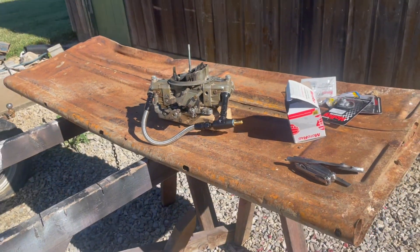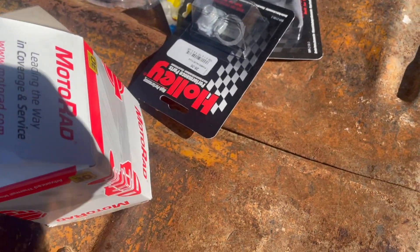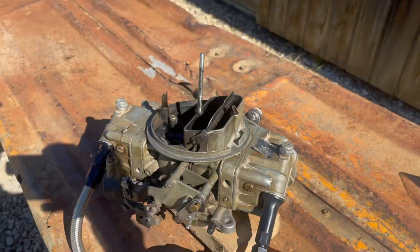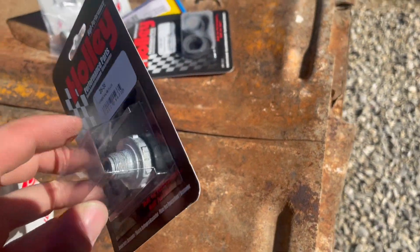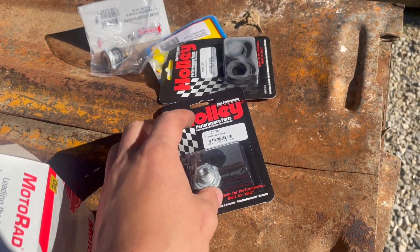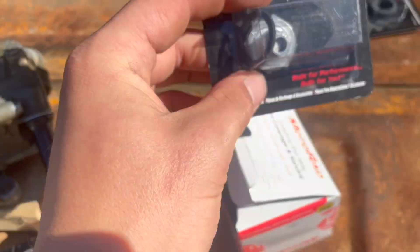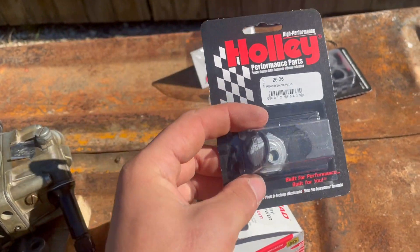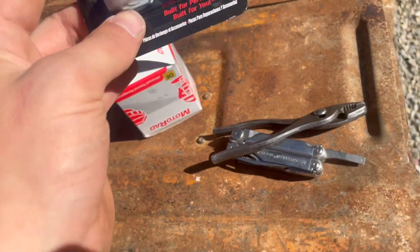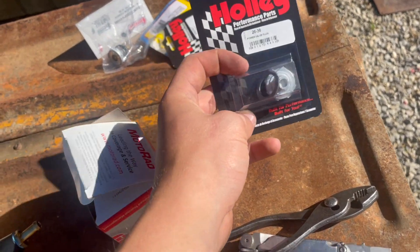Here's what we got on our carburetor — it's not really a rebuild, just adding a couple of components essentially. First, we have a power valve lock-off plate for the secondaries. I was just going to JB weld an old power valve together, but this is only six bucks or something like that from Holley, and it's an actual core that hasn't been drilled for it. So that's going to be better than JB welding anything — it still seals with a regular gasket. We're going to be installing that in the secondaries.